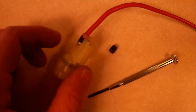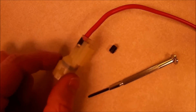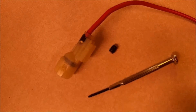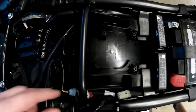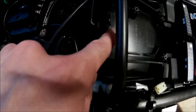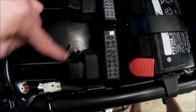My plan right now is to use ground off of the frame ground or find another source of ground rather than using the ground wire on the connector. Looking underneath the seat of the Honda, the optional power connector is normally right underneath this bar right here. I've removed it from its little mount — there's a tab on the connector you can push and it just slides off the mount — and I've rerouted that wire.